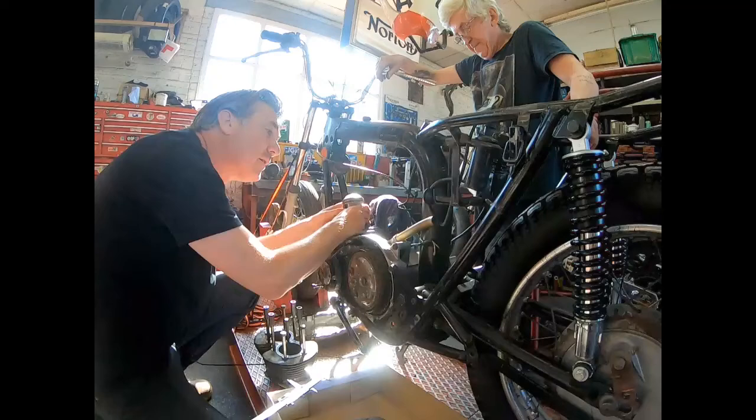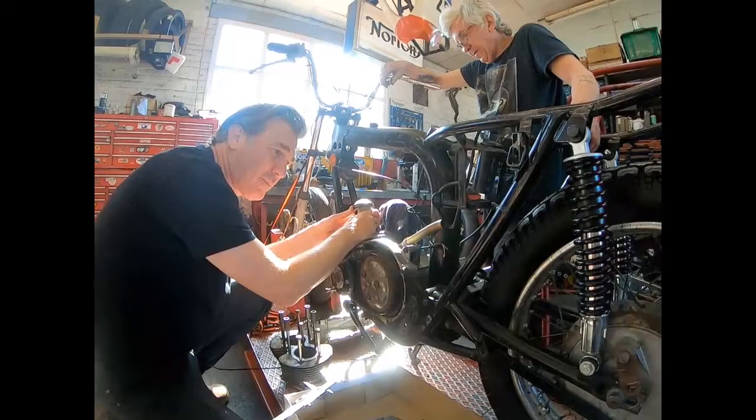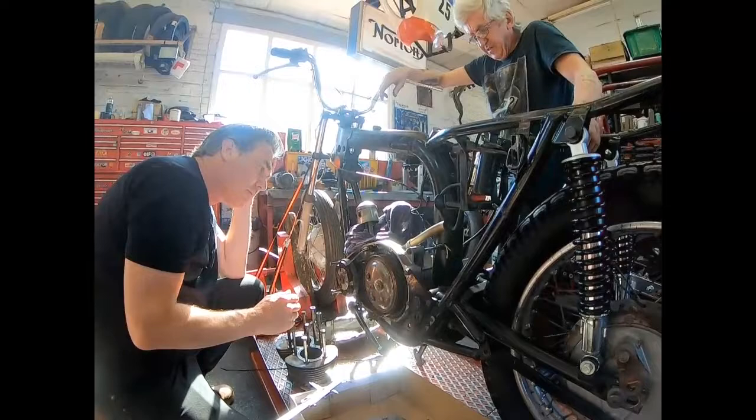There's no play on the big end either, which is good. So we might even be able to just leave the piston rings in. You can put a loose head in — par for course.